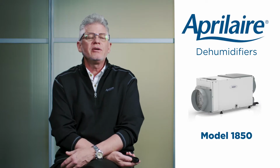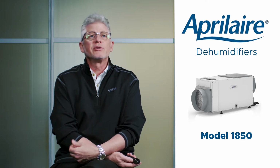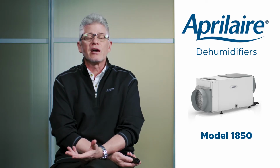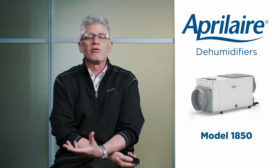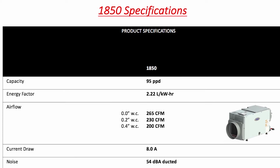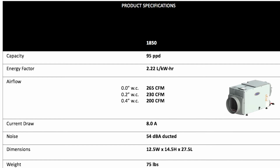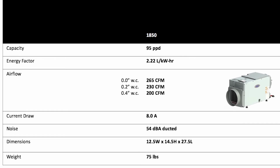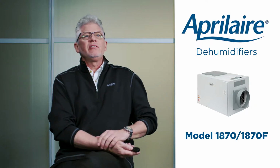The model 1850, this is sort of the workhorse of the line. This is 95 pints per day. To put that in perspective, a pint of water weighs exactly 1 pound. So if you think about this, the product takes out 95 pounds of water a day. Now it's 2.2 liters of water removal per kilowatt hour. It's got a lot more CFM. It's running over a half a ton of air over the coil. It's a 265 CFM blower. Draws 8.0 amps, and it's about 54 dB. Weighs about 75 pounds.